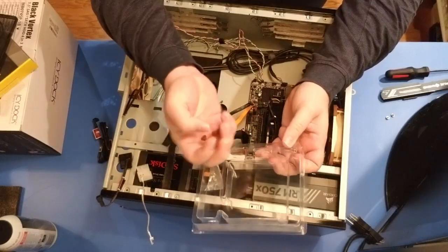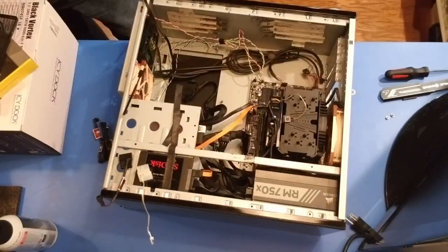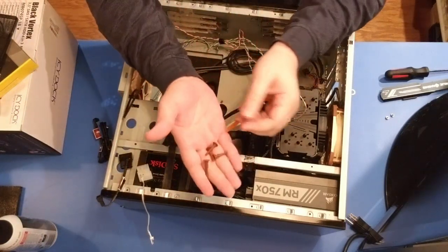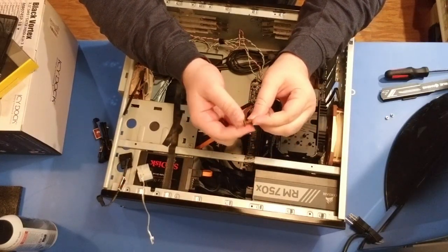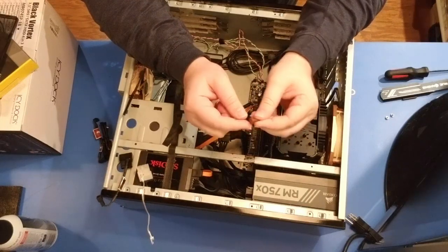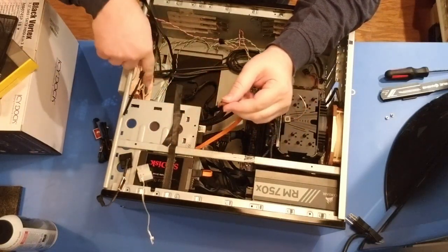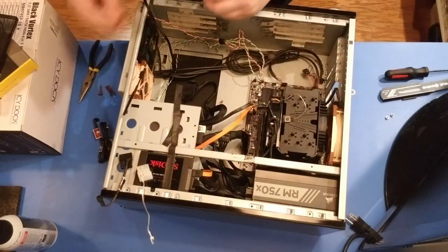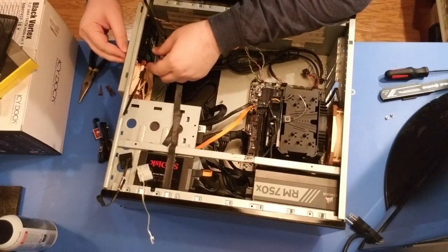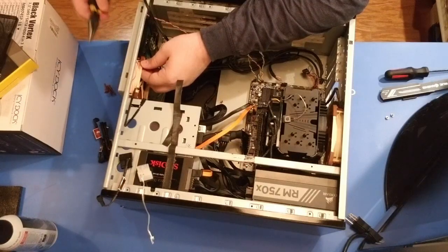We use these little rubber mounts, which you need to get your grips out for. Instead of using screws to tie the fan down to the case, you use these little rubber mounts and pull them through. We'll see how it looks in a minute. And when you pull these guys through, now it's rubber screws on a rubber mount, and there's just total isolation of the fan from the case. I'm not always a cooling guy, I'm kind of a sound dork. I like things to be quiet.